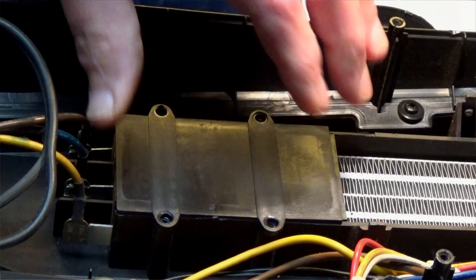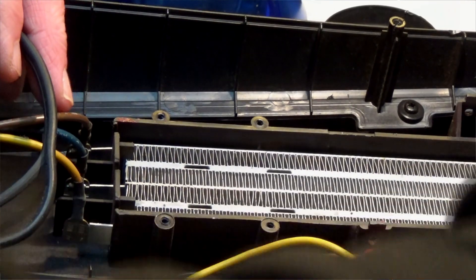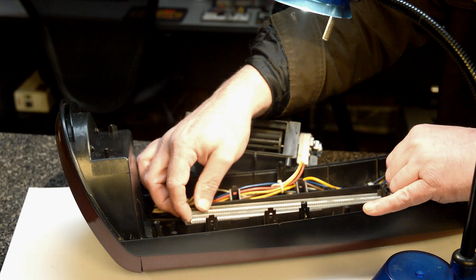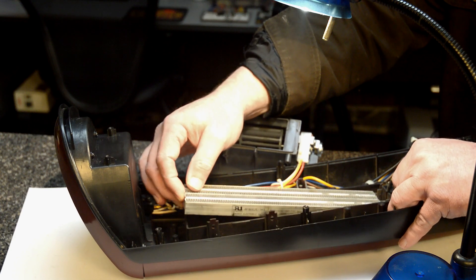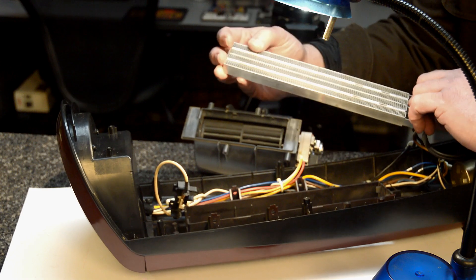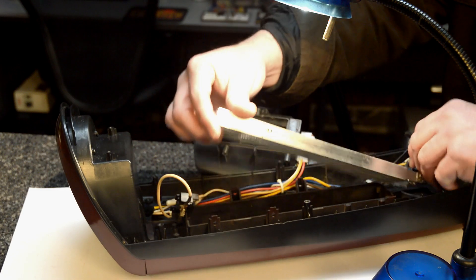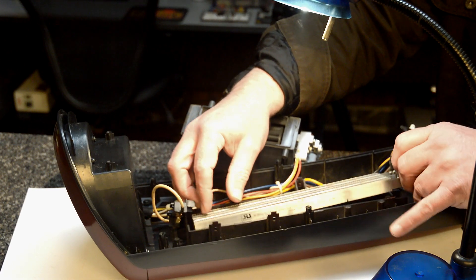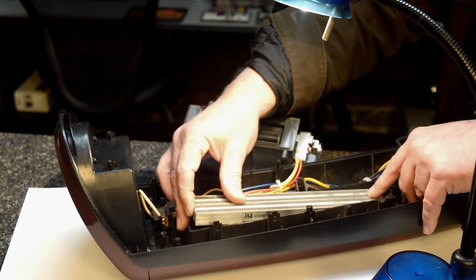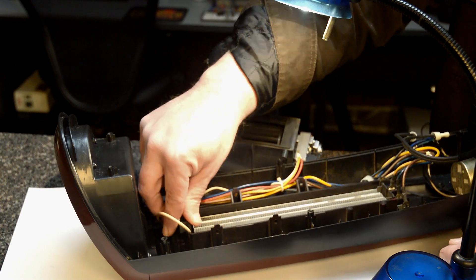What kind of surprises are under here? More of the same. So get your vacuum under here and clean all that out too. By this time you should be able to pull the element out itself — just very carefully lift up on it and see if you can get it out on each side. On this one you have to pull the back end out first. Now you can really clean: clean all this out, clean all that out, clean the front. And this thing's like brand new. To put it back together you just have to do everything in the reverse order — this side has to go first, then push down on that.